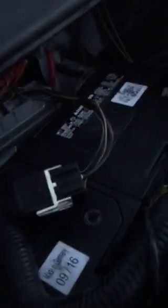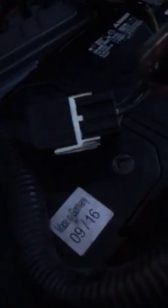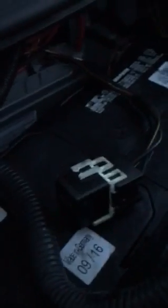And then, I'm just not sure if you guys could see it very clearly, but what I'm going to do is take this concoction that I made up and very quickly touch the back of the wire. Now I'm not getting anything in this case. Okay, so obviously that's the incorrect side since I don't have anybody turning the key for me at this moment. So I'm going to turn the relay over and, as you can hear, the car tries to crank.